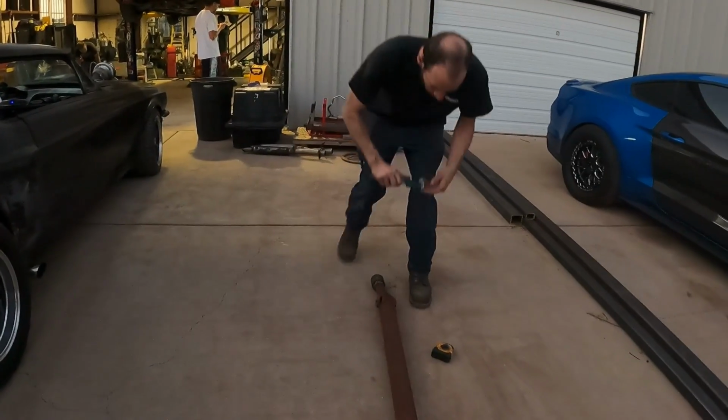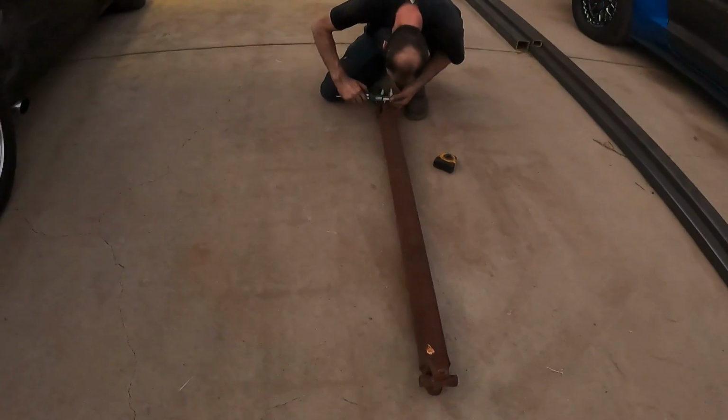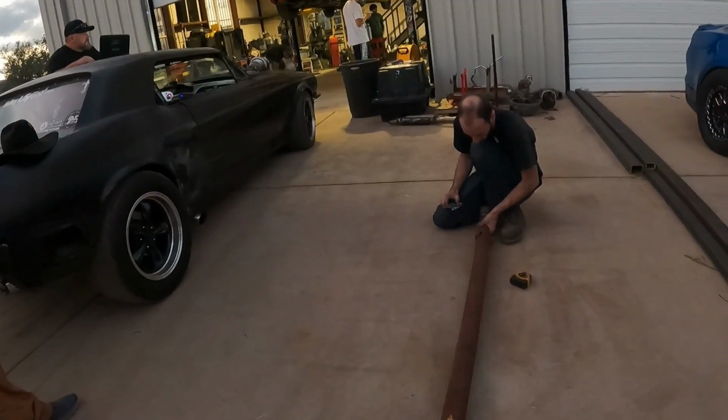So we're looking for a new driveshaft yoke with a 1350 or 1330 U-joint. See if we can toss it back together and put limit straps on the axle so it can't ram itself into the output shaft of the transmission. Doing some math to figure out U-joints and see if what remains of this driveshaft will maybe replace ours. But it looks possible.